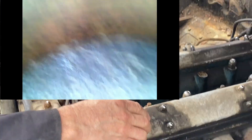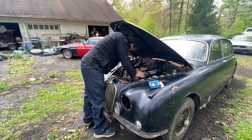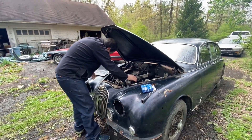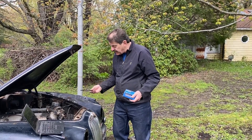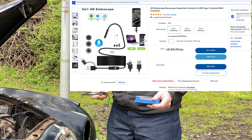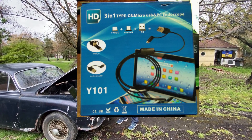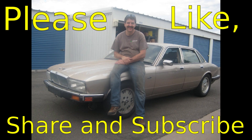When you look inside the cam cover where you add the oil it looks okay there, but the cylinder bores are just toast. It needs a lot of work, and I think the carburetors are in rough shape too — the linkage is really stiff, so who knows what it's like inside the carburetors. This USB borescope endoscope actually worked really well. At only about $11–$12 on eBay with free shipping, I think it's something everybody should have in their toolbox. I can highly recommend these — they're pretty useful and easy to use. Hope you enjoyed this video; leave a comment below if you have any questions.